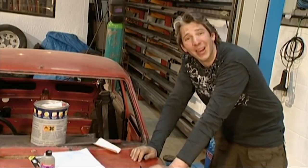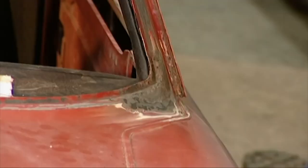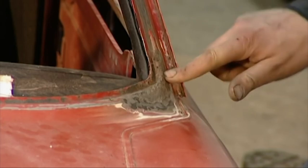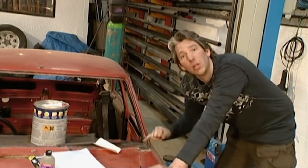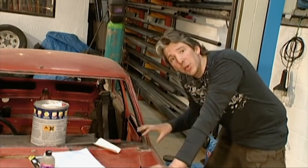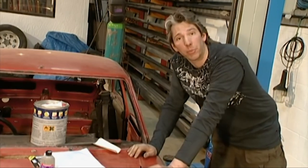Earlier I mentioned this car had some pretty bad areas of rust. One of the worst parts of the corrosion is up here on the scuttle panel, and that's why I had to take out the window. But after further inspection it seems it's only on the surface, so all I'm going to have to do is treat it, put a bit of filler in, and then finish it off with some etch primer.